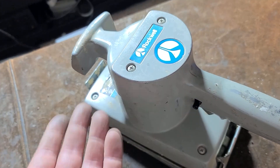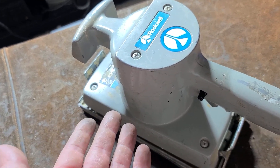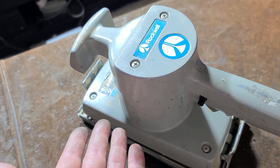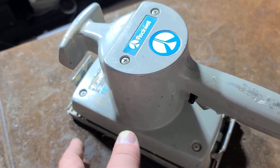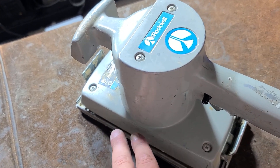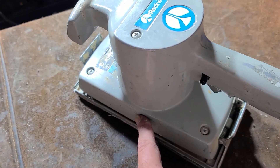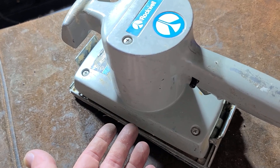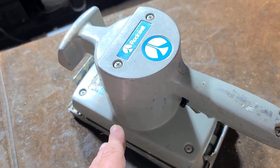But also in this video — like I do in this sander — this doesn't have many hours on it. It's a little dusty in here. The bearings were just dried out. So I did the poor man's thing where I show you to use picks right on the outside edge of the seals on these two lower bearings, pop out the seals, put in some new grease, wipe the grease off the old seals and reassemble them just to get some more life out of them, which is something you can do.